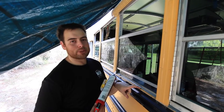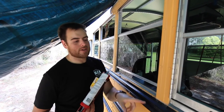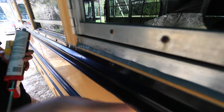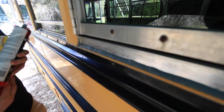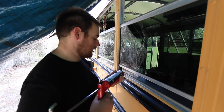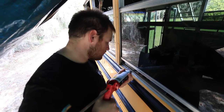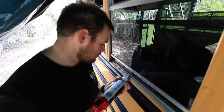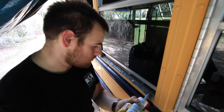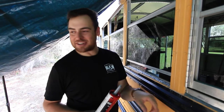As you can see, we've got the butyl tape that we put in when we put the windows back in, and now we're going to add caulk on top of that. If you look at this window, my dad's been coming back with some rubbing alcohol on his fingers and pressing it in nice and tight to make sure it's a good seam. You're just going to squeeze and kind of drag it along and try to fill it as best you can. Brand new tube moves way faster than one that was already open.